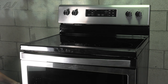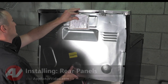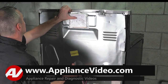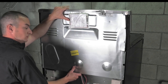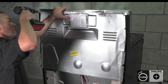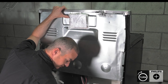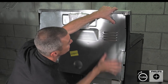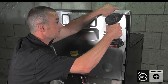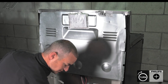Now we need to gain access to the back of the unit. To install the rear panel, you must first slide the top of the panel up under the console. Line up your screw holes, hold the panel, and install one of the screws to hold the panel for you. Once you've got that one in, move on to the other side while still holding the panel. Once you've got that one held, you can finish the rest of the screws.